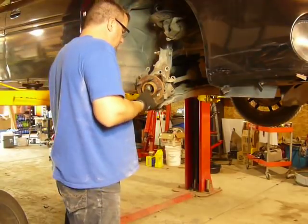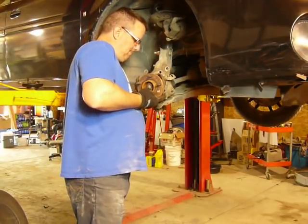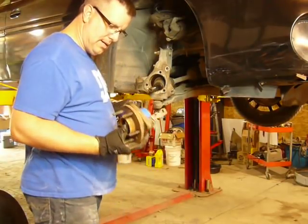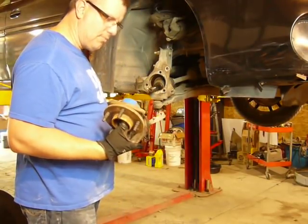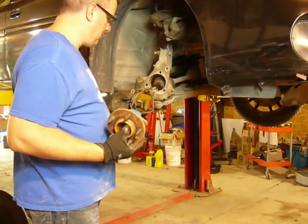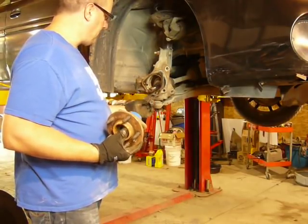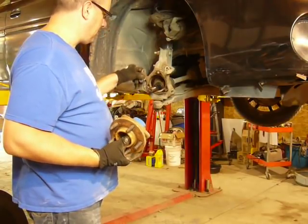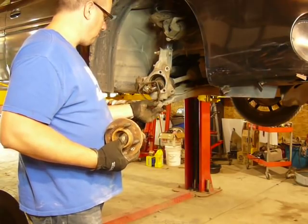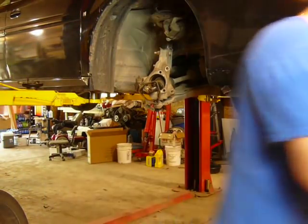This bearing was just replaced by someone else, and I'm thinking maybe it wasn't torqued right because it's a moved bearing. It shouldn't have gone bad. It was just replaced 5 months ago, so it shouldn't be bad already. Always pay attention to how that comes off there because you can clearly put it on there wrong, and you'll be hating yourself by the time you get to that point. Then go grab the new bearing. We'll put her back together.